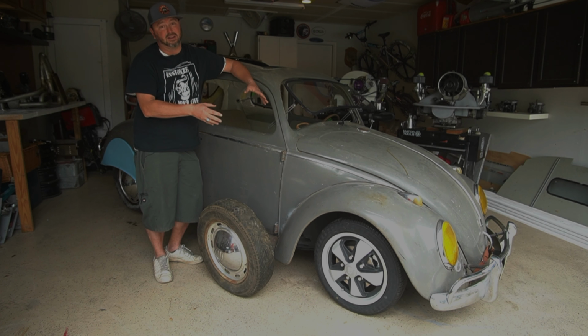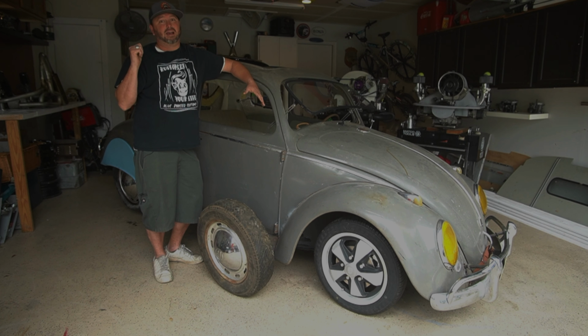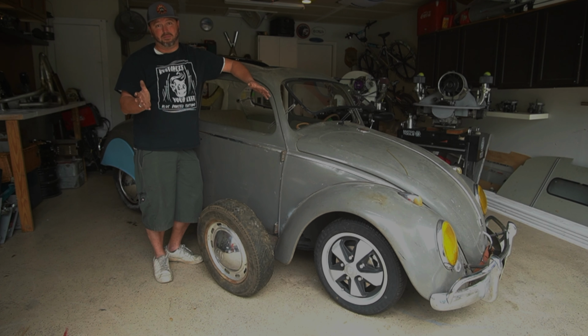But now that we've got these on the front, we got to do something about the back. We already replaced all the brake shoes and the springs and the clips and everything in there, but they're 5 on 205. They're the wide 5 pattern, and I gotta have matching wheels. So what I did was I ordered some brake drums with the 5 on 130 pattern from our friend Daniel at Oak Hill Automotive, and that's gonna allow us to run the Porsche wheels on the back with no adapters and no spacers. I hate spacers and adapters. I just don't like them. So we got drums that'll slide right on. They got the correct pattern on them. Bolt them up. Everything's going to fit nice.